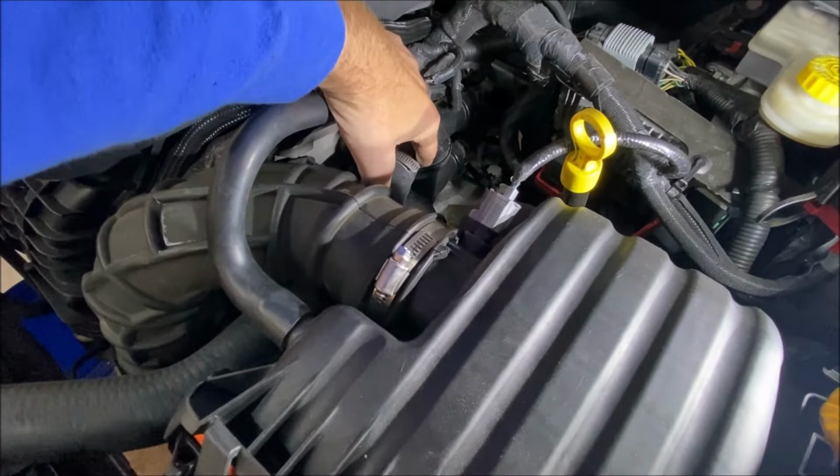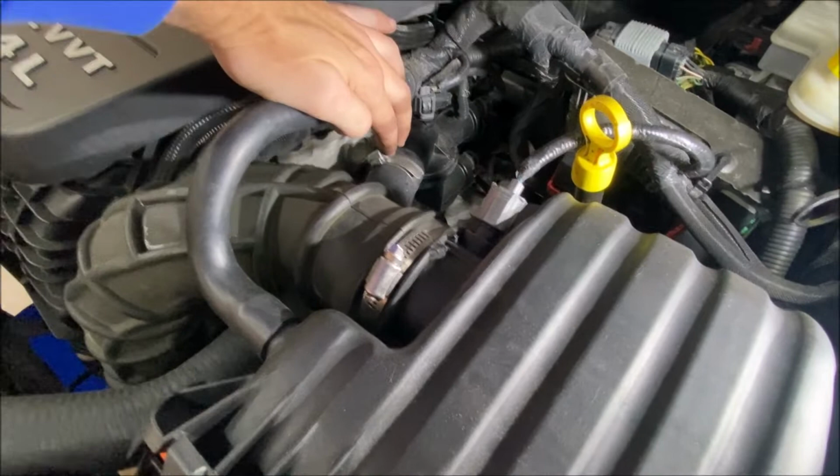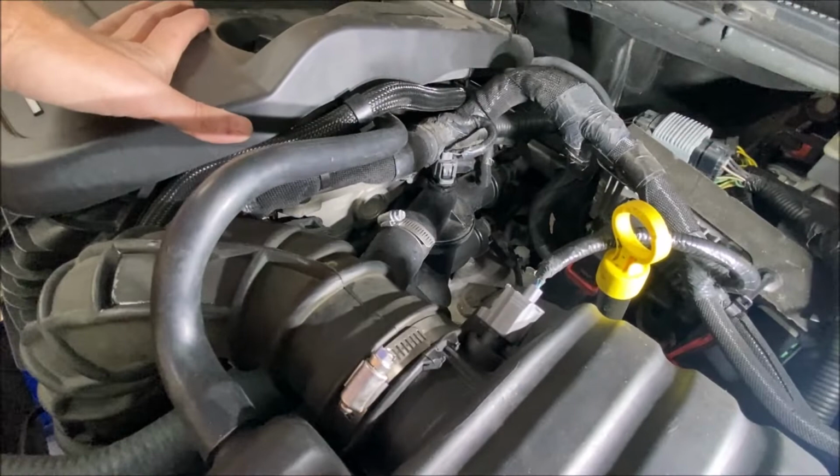There's two outlets that go, I assume, to the heater core and radiator inlet and outlet. And there's actually some seals to the engine itself on the side. And there's actually two thermostats. One is in here in this top housing, and one is between the engine and the plastic housing. So if you're going to replace just the thermostats, make sure you get two of them and they're different sizes.